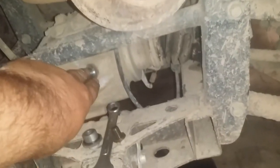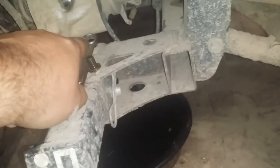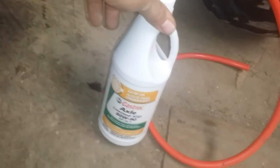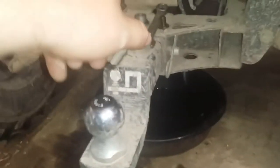Remove your fill plug first, then drain your fluid into a bin, and put your fill plug back in. Get some gear oil — whether it's Yamaha brand or another doesn't matter. I have limited slip because it'll lock her in. Front axle, rear axle, it doesn't matter.